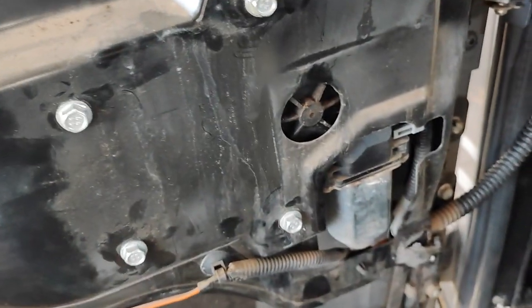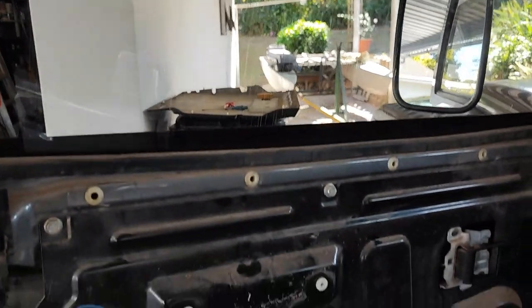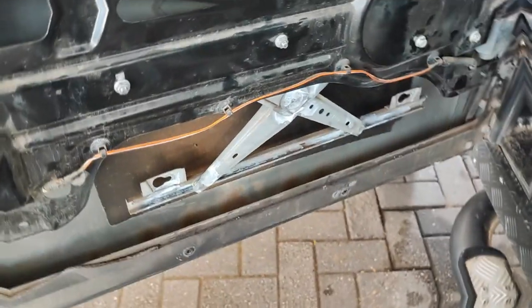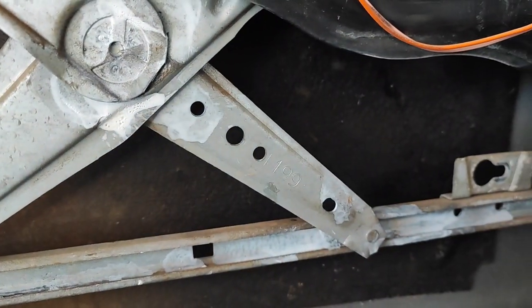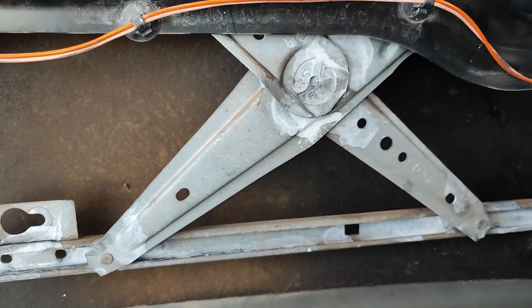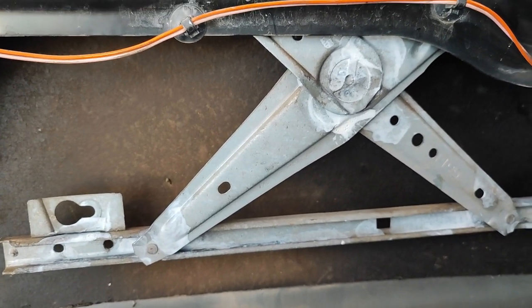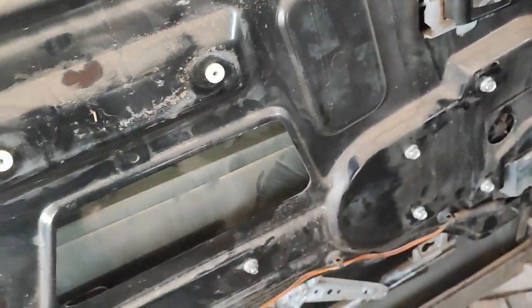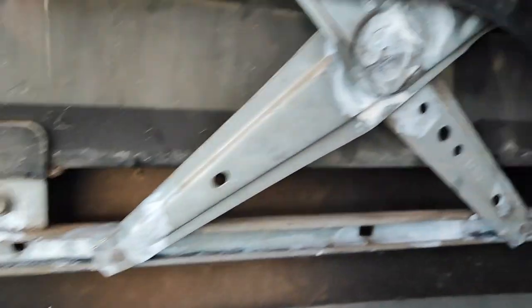We've got that all tightened back in and the motor reconnected, but the glass is still standing at the top. I'll put the ignition on and drop the window. I've dropped that down now and I'm going to bring the window down — there are two bolts on the bottom of the window that are going to go into the mechanism. Guys, if you do this, these are like a pair of electrical scissors — do not put your fingers in the way with the ignition on. I remember as a young boy my dad got his fingers caught in a wiper mechanism and he nearly lost his finger, so be careful. We need to line those up, slot them in, and tighten them up — both of them in and tight.